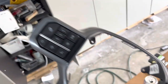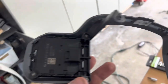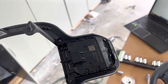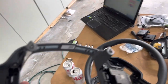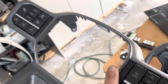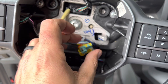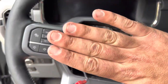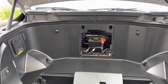We got the new buttons swapped over — you can see the one that has the following distance indicator in the corner that didn't have before. Got those tightened down — just those three little Torx screws. I checked the harness with the old and new one and they're exactly the same, so no need to swap them. We'll get this plugged in and hooked up. Remember to push those orange pieces down after you plug them in, or these will not work — I had a problem with that before. Then the airbag just pops in, held in with some little clips.